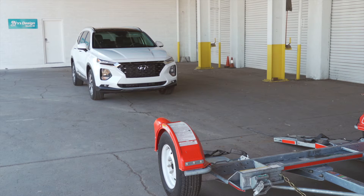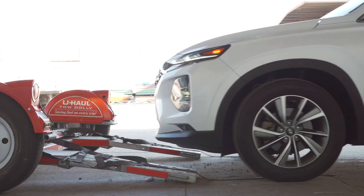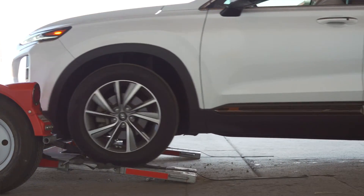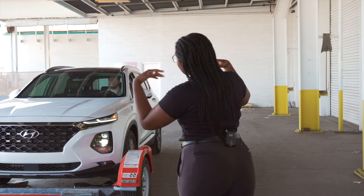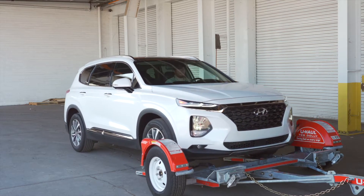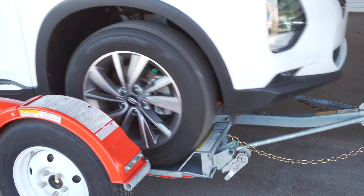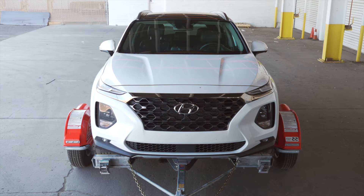Center the vehicle to be loaded behind the car dolly. While loading the vehicle, drive slowly and have an observer make sure that the front of the vehicle does not hit the ramps. During the loading process, have your guide stand off to the side. Continue slowly up the ramps until the vehicle's tires come to rest against the stops at the front of the dolly. The vehicle should be centered on the platform. If it is off to one side, you need to offload and reposition.